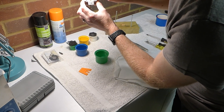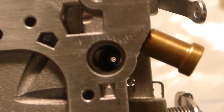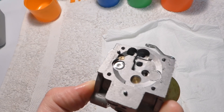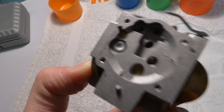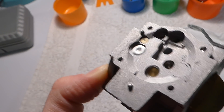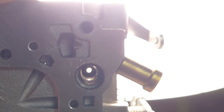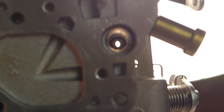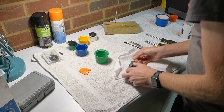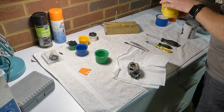Where the metering needle goes in this area — the port from this side to the fuel pump side — I can see it's slightly blocked. There are very fine particles in there, and it's very difficult to see unless you've got pretty good eyesight, but if you're showing it up to the light it's clearly got something in there. It's particles, and I can show you what it looks like.